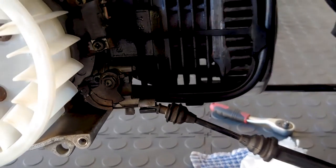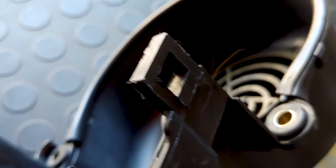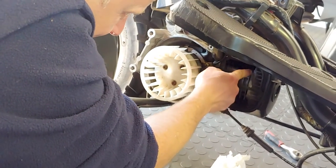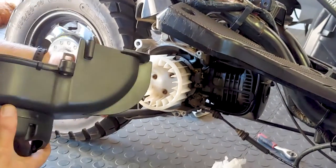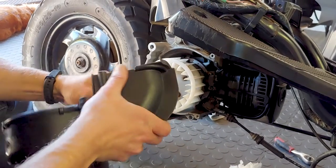The right-hand cowl has two clips — one that clips against the two-stroke pump and that little female side of the cowl whose male counterpart is on the barrel. We're also just confirming that the head gasket is indeed on, because I left the apprentice to do that by himself — just making sure it was done.